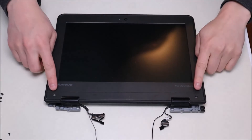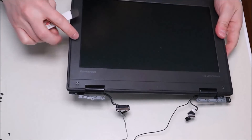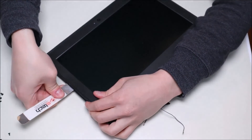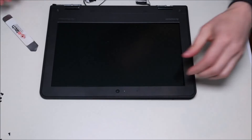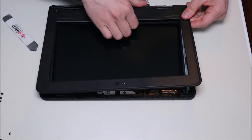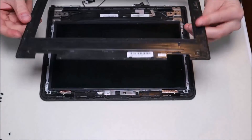Here's our LCD assembly. There are two screws underneath black stickers. Then take the flat metal pry tool and go around the seam of the bezel and the top case to pry them apart. Be careful not to put your tool too far in while prying up the bezel — you don't want to damage the LCD. A lot of these bezels are held on by double-sided tape once you get the screws out. Just go around and release it, trying not to crack the bezel by folding it too much — and the bezel comes right off.